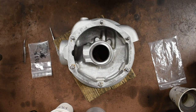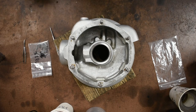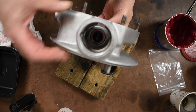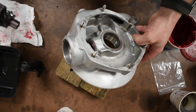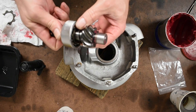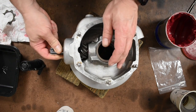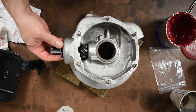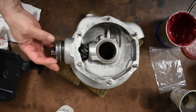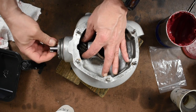I'm going to put 28 of these needle bearings into the pinion shaft. So I put 28 rollers in there — probably can't see that, but 28 in there. There's the inside race. This had a shim on it when I got it, so I'm going to leave that there. I'm going to put this in, put the spacer in. This is an R51/2 so it has a left-hand thread. Just going to hand-tighten it.